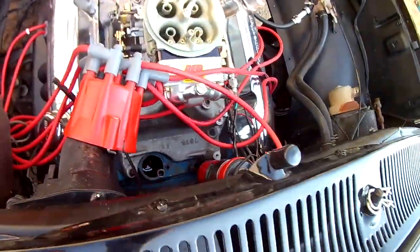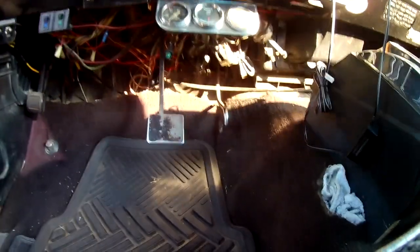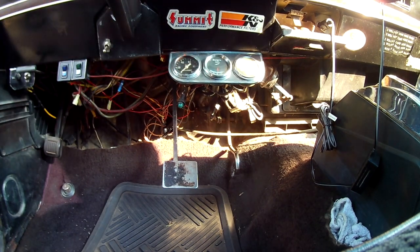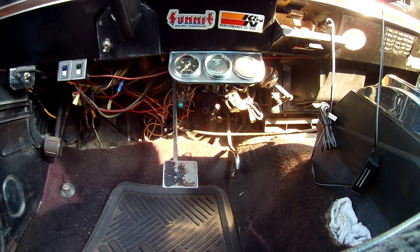this is ready to go back in. So it's on, filled up. I've got the shaft down there, oil pump drive shaft. Got my drill ready. I'm gonna stick this camera in like this, and hopefully you'll be able to watch the gauge here on the left. That's oil pressure. We need to see that move. If it doesn't move after a little while, I'll turn the motor over and hopefully we'll get oil pressure back. So y'all keep watching. I'll see if it works.